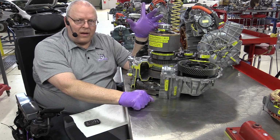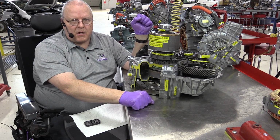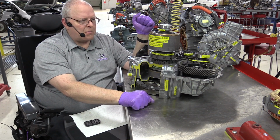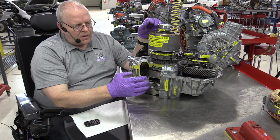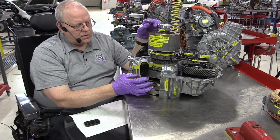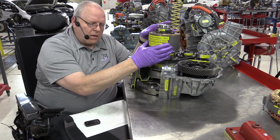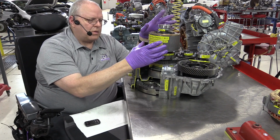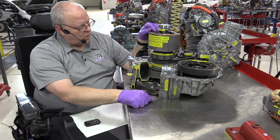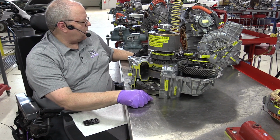That rarely happened unless you, like those magazine articles I talked about at the first of this video, were driving up a super steep long mountain pass. But that turtle light is gone in the second generation Prius. Higher voltage, higher power, stronger magnets, stronger, higher torque motors.